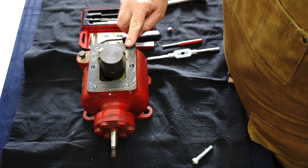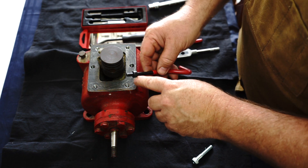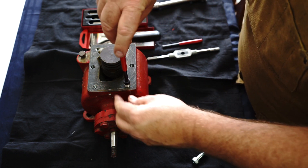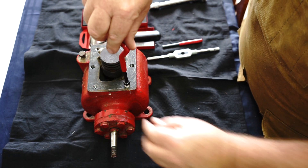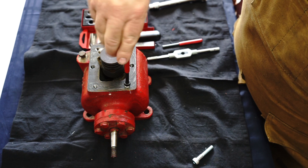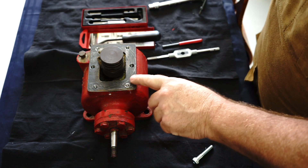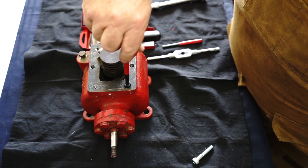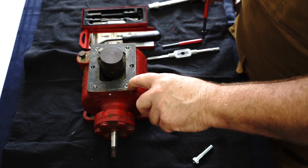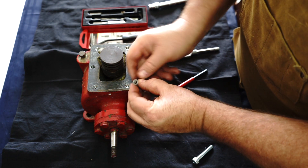Off camera I've fitted the rear two helicoils. It's quite simple to install — you set the stop with a little flat-head screw, then insert the helicoil on the applicator and simply screw it in, just like screwing in a bolt. If you've set the ring correctly it will bottom out and go tight on you. You want the helicoil just slightly below the surface. There's a tang on the bottom that you'll need to break off — that's the applicator tang and it's designed to snap off.